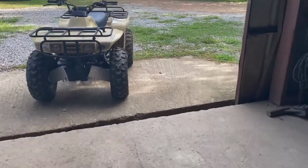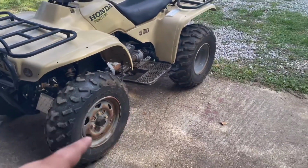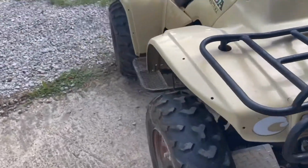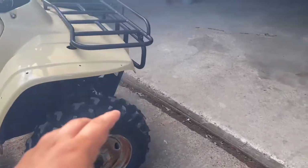Over a span of a certain amount of time, we're going to get either 30-inch Moto Havocs or some 32s of some sort. I don't know if any of y'all know, but Moto Havocs do measure up. So probably some 30-inch Moto Havocs and fender flares, of course. We'll do a 54% gear reduction. And since this is a '99, it is the third gen, so you can do the Honda Rancher 420 shocks on the front, give it a 3-inch lift, and then we'll do probably a different rear end in the back, or might just rock this until it blows, and then do a 2-inch or 2 5/8 inch stretch using the solid front drive shaft from the first gens.